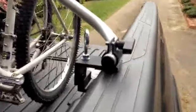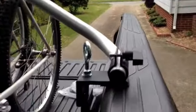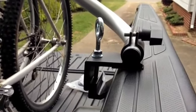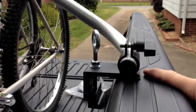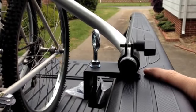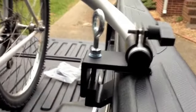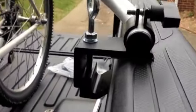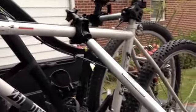So we're back here. I decided, because I like the idea of being able to put your bikes in the truck without taking the wheels off, I decided not to send this thing back for a refund. Instead, I modified it and I'm going to go over the modifications I did. I took my metal cut-off and cut that lip off and used my angle grinder with a metal sanding wheel and smoothed off the surface and clamped this thing down. After making this modification, I have a very solid tight contact there on the surface. The bikes absolutely are not moving despite me shaking them. This is a solid setup. Front tires are secured with these straps — there's two of these that came with the kit. I'm shaking it right now as I talk to you guys and they are not moving.